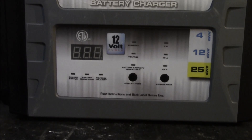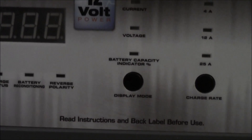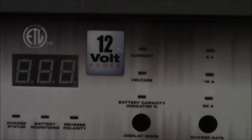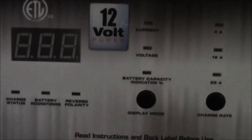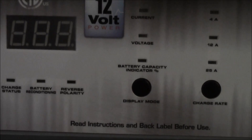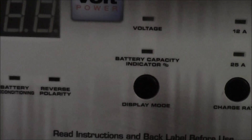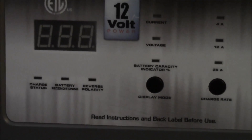The other chargers all have a needle indicating amperage, but to me the analog needle is inaccurate and hard to read. I personally prefer a digital readout — it's way more accurate. You have to understand that the difference between 12.1 volts and 12.6 volts is literally a dead battery versus a fully charged battery, so you need accuracy to a tenth of a volt. There's also another button — when you fire this charger up it shows current, and pushing that button shows real-time voltage output.